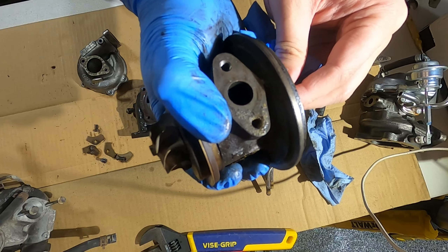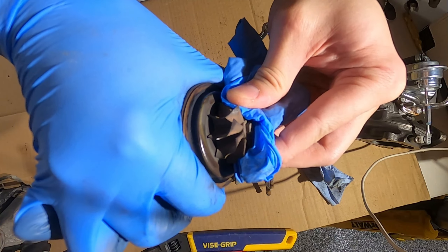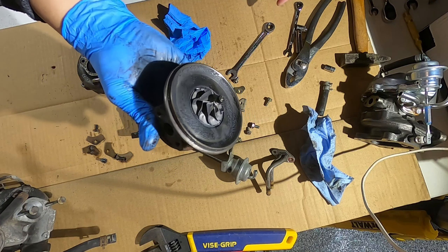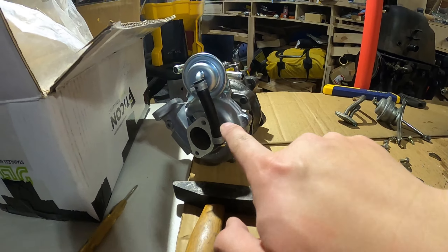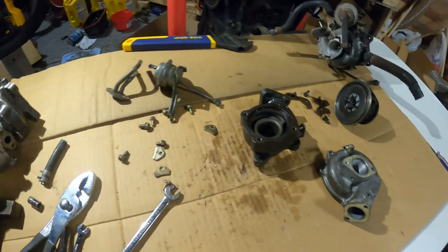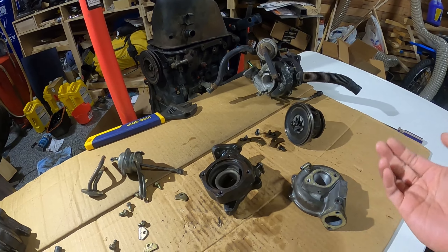There isn't any in-and-out play on this shaft, but there's a little bit side to side — it's really hard to show on camera. This is what it looks like inside an RHB 31 turbo and how you would take it apart. This was the VZ25 submodel, the VZ24 Cappuccino one, the RHB 31 FW, and the Hyper VZ21 — they're all very similar since they're based off the same design; compressor wheels and aspect ratios may differ slightly.